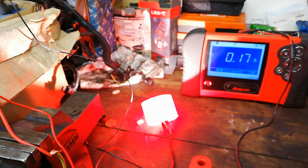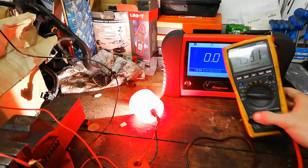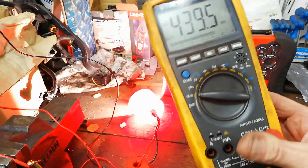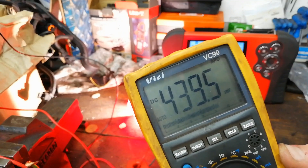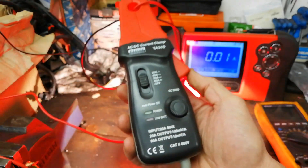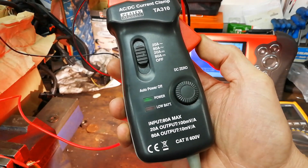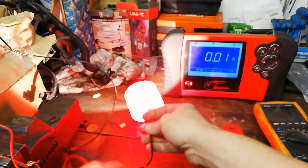Now, you don't need a fancy Vantage Pro. You can do this with an ordinary voltmeter. The clamp on the positive there — just on the ordinary voltage scale, connected into the ordinary volts — it's giving a reading in millivolts and you just have to convert that yourself. It'll say on the ammeter. I'm on 20 amps, so 100 millivolts equals an amp. You just do that calculation. So all the Vantage Pro is doing is doing that calculation for us and displaying it in amps.